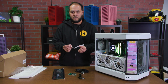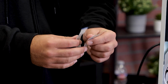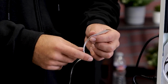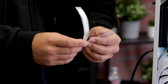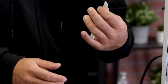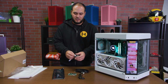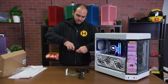As far as worrying about stuff that's fragile or easy to break, the only thing you really have to worry about is this ribbon cable. Again, this is the embedded DisplayPort ribbon cable. Once it's plugged in, you want to just be very careful not to pull on it because you could break the connections to the board or the LCD itself. But otherwise it is fairly flexible and you can bend it. I wouldn't crease it super hard. It can make some pretty tight bends here, but don't fold it on itself because you could break some of the connections inside. Open up the LCD itself.